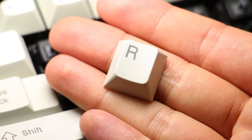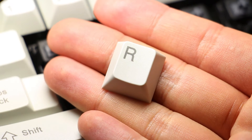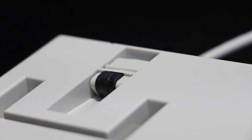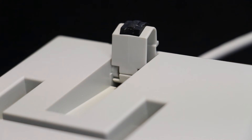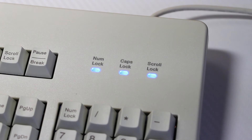Because you have the ability to swap switches on your keyboard, you can buy sets of key switches online so you don't have to buy more keyboards just to experience different types of key switches. There's nothing special about the keycaps, just your regular average pad printing, which means you can feel the printing on your keys. The feet are pretty basic, just a flip foot with no click to keep it in place, but it does have a nice rubber tip for good traction. As for the LED indicators, it's pretty simple — nice blue LEDs for your num lock, caps lock, and scroll lock, which would look pretty great on the black model.